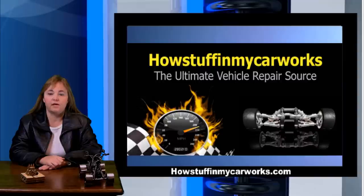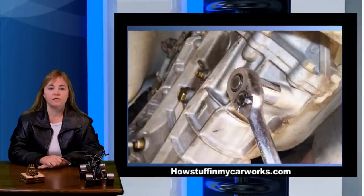Lift the front and rear side of the truck one at a time and place jack stands under the rear axle and the front of the frame. Disconnect the negative battery cable for safety. Locate the transmission oil drain plug located at the bottom of the transmission shown in the image and drain the oil into a clean drain pan. Once the oil is done draining, install the drain plug back on.